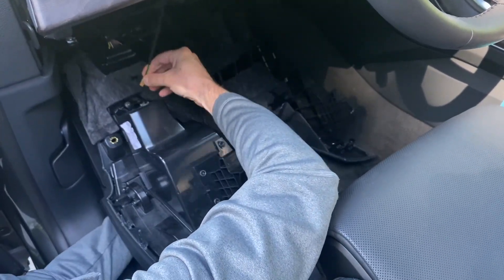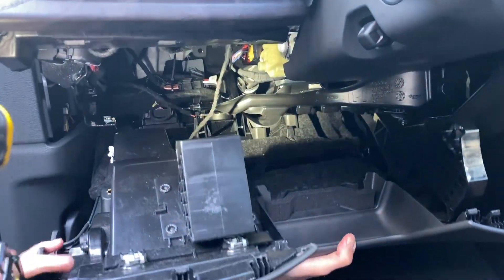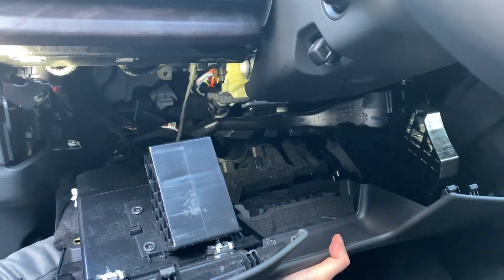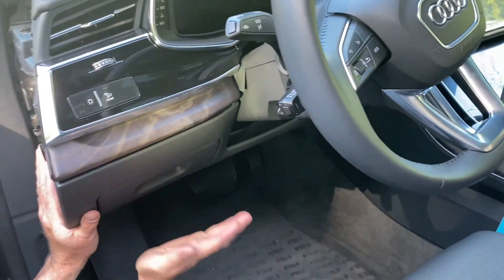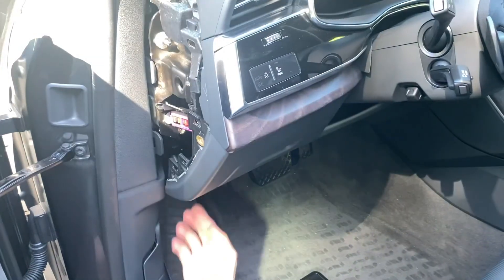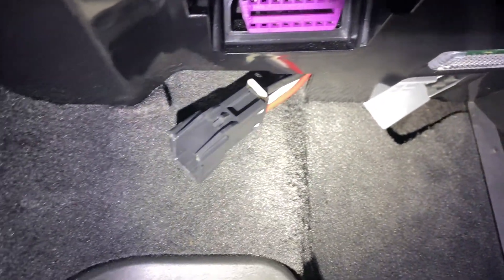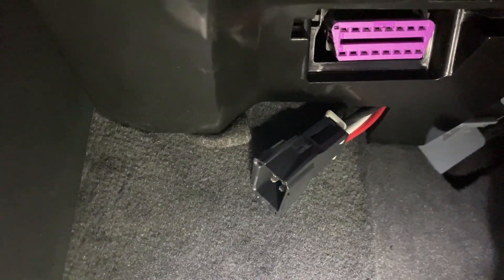I'm going to reconnect the speaker in there. You can see in here this is where I've got the harness tucked away. There is a gray tab here — you want to make sure the plastic goes into this gray tab. Now push that back in, clip it up here, and your dash is installed back in. We need to put the 8mm bolts back in here and also the two 8mm bolts in here. You can see the harness is now being pulled through by that terminal. All you should have showing is this part of the harness that your brake controller will plug into.